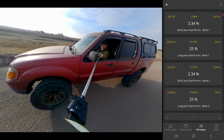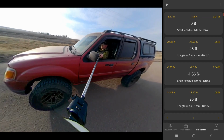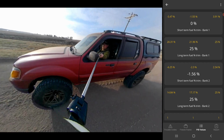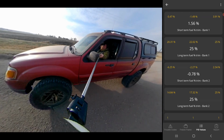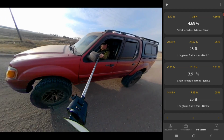During a test drive, I used the OBD Link to monitor long-term fuel trims. Fuel trim is the measure of how much fuel the computer adds or takes out of the engine in terms of percentage. Ideally, we're looking for anything under 5 to 10% positive or negative. Anything above 25% in either direction and the computer stops reading and throws codes. Well, there you have it. Under load, we reach 25%. Let's check for some vacuum leaks.